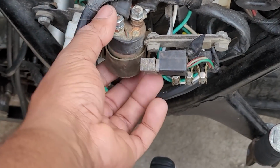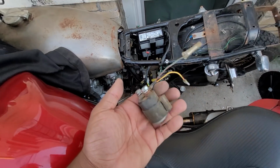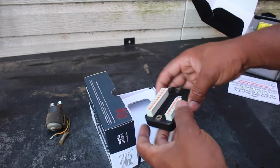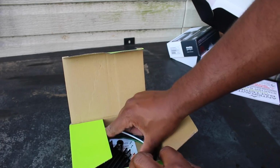One thing that I would definitely need though is the starter solenoid, this little guy right here. Right, let's hit up the now ant-infested workbench out back. The starter solenoid, the M unit, and the battery will be the big components for the tray. I thought it would be big enough to put the regulator in there as well, but it looks like I have to stick that on the underside of the tray.